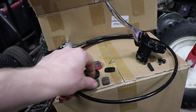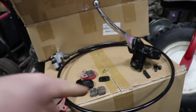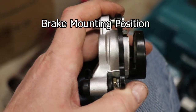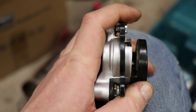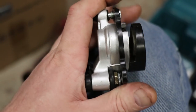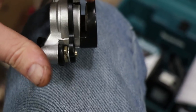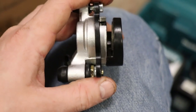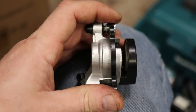If my alignment is a little bit weird, or if I need to have the pads a little bit closer together, I might actually opt for this thicker pad and put it here in the hydraulic brake. I want to explain some issues people have had with these calipers. One common complaint is that the pads don't line up. Well, I showed you that you can put a thicker one in right here using your existing brake pad - pads are super cheap. I've got a link in the description for that, and you can just buy replacement pads that'll be thicker.